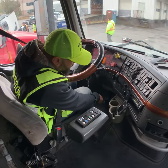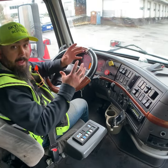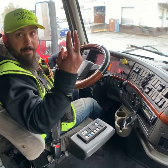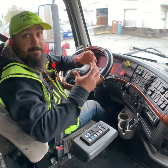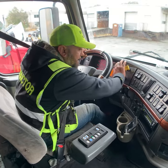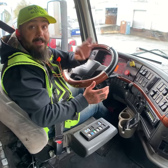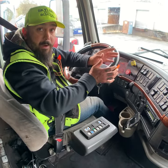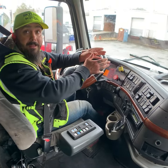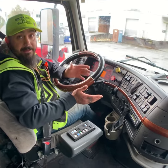And the last one, I want to check my service brake. For the third time, number one, service brake, D, or drive. Number two, while you are doing, explain: to check my service brake, I release both tractor and trailer brake. For tractor brake and trailer brake, number three is I try to move the truck forward, but for service brake, we have to say I move the truck forward 5 to 10 feet. Some schools say 10 to 15, 10 to anything.